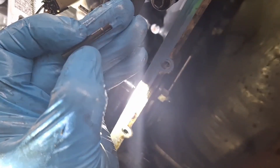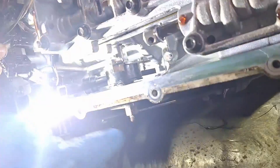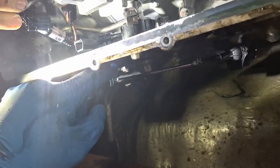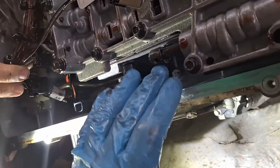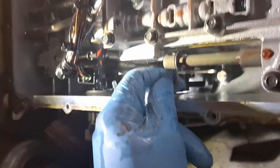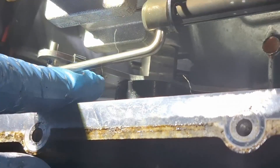You see how one side of the drift pin is a little smaller than the other on the right here? You need to put that side up. I do have that drift pin in there far enough to where when the lever rotates here, it's not going to rub on the casing or the valve body. Now I am going to have to pop the shifter cable back off of here and rotate this back to the low position so I can have better access to put that little rod back. I am going to go ahead and put that rod in here — pop it into that other location there. On your new sensor, you need to pull this down until it clicks and it'll pop into that hole right there.